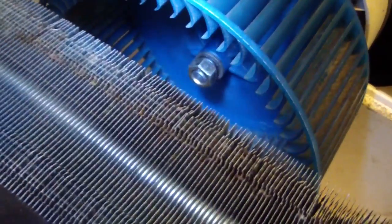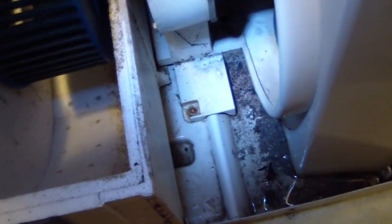The first thing you gotta do is pull those screws, get that plastic fan shroud so you can move it. Then there are bolts right here, here, one down here, and one down here — it's a three-point mount. There's also a bolt in here — you gotta get that removed. And then there will be another one in here once you get this whole housing removed, on the end of that blade. Don't forget to get the screw out down here, and there's another one on the other side of this motor. Otherwise you're not getting it to move for that assembly.